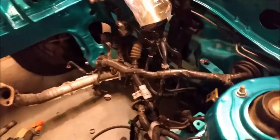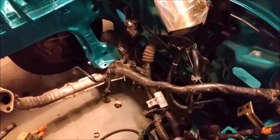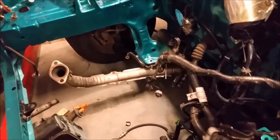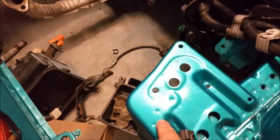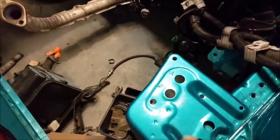Now, the wiring loom is loosely threaded through. Two main looms go into the vehicle, one there. Much easier to thread the wiring, the main parts of the wiring, through now before the engine's in situ. So what we'll do, essentially these engines, and there it is over there, are designed to go in through the bottom. When the cars are built, the engines are put in with machinery from the bottom. And in servicing is the same, because we have a large battery tray there which we can't remove because it's structural. There's a mount for the engine underneath.